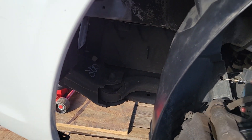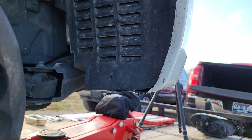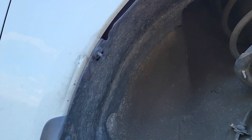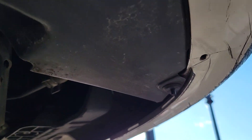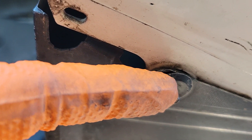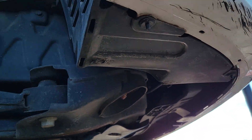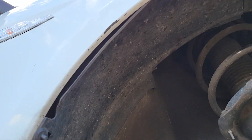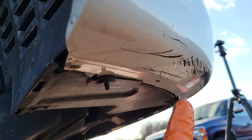Underneath, there's one tab here and one over there, which I left. So take those off. This is what it looks like when it's on the vehicle. This side has rivets — I replaced this fender when I bought the car, it was missing, so I actually just riveted them in. You can see the little rivets there. I am just going to cut that and pop it out, then get a new rivet and put it in there. You can get that rivet tool at Harbor Freight.